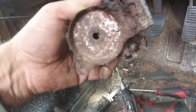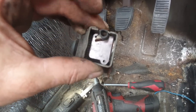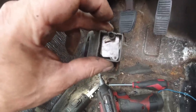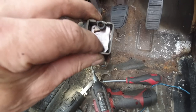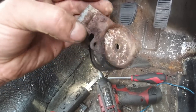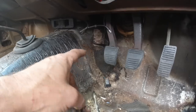Not much corrosion on the car. I would say the reason that's corroded is it's leaked on itself. What would have happened is the heat, it just can't take it. Hot climate, that will break down there, start to leak. So I bet you the owner had problems with this. We can ask him because we're in touch with the owner. I bet you that leaked onto the switch, corroded the rivets of the switch, then it broke apart, then the rest of the water ran down, and it probably half worked for a while, and probably leaked for ages and half worked, and then it's rotted itself, because no water comes down that area, even when the cars rot, unless they were really bad.